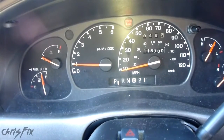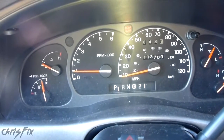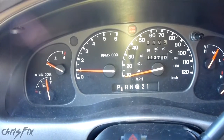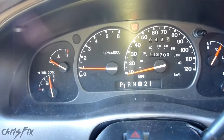There are also other codes. Code 19 — that's usually after your car gets into an accident or if the airbag has deployed. It's the restraint control module memory and it's full. You just have to replace that RCM, and that's the only way to fix that.